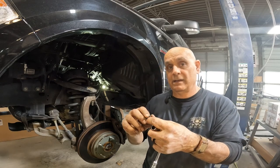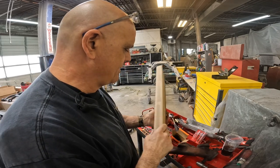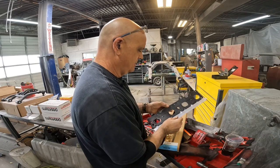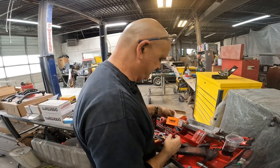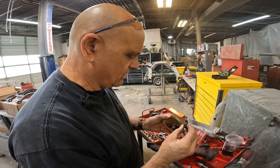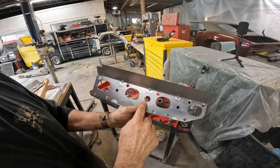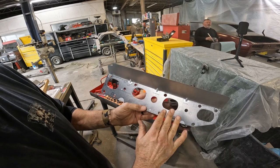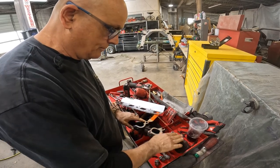We just got some parts in. The gaskets are MS-97083. The bolt kit is a Dorman 0-3-3-0-9. Doing a little research, the only ones that get Loctite are the end studs. One thing to keep in mind when installing gaskets — make sure you pay attention: this says 'to the manifold.' The metal goes towards the block; the felt side always goes towards the manifold. Make sure before you go back with the header you clean it all off — get a little zip gun, a wire wheel, or whatever you've got at home.